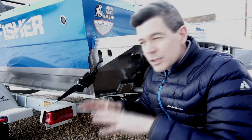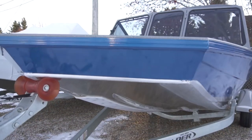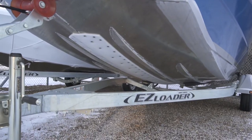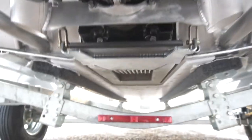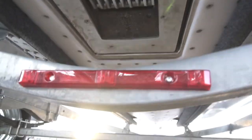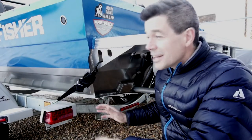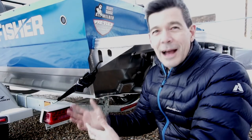When you're up on step, the keel — the center of the boat — is all that's really going to be in the water and vulnerable to any kind of hits or impacts. In that area you've got a half inch of aluminum and then a half inch of the UHMW that you've seen from the front. You can see how it's protected all around the intake grate as well. This boat has a lot of extra protection and it's a fabulous choice for shallow lakes, but we've beefed it up so it's a great choice for rivers around here.